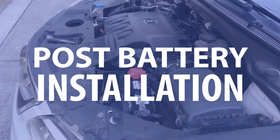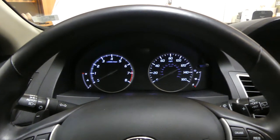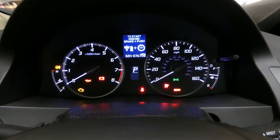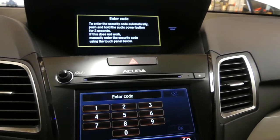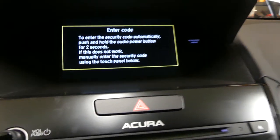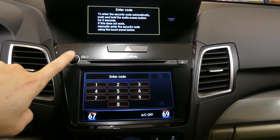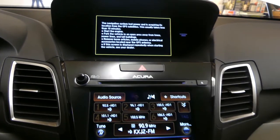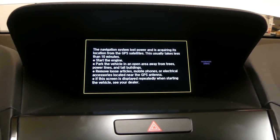I like to do a quick test by turning on the ignition and making sure the new battery works and all the connections are solid. If the engine starts up and there are no electrical issues, then you're pretty much done. For those that have the Acura RDX with the technology package or advanced package with the navigation system: after restoring power, your navigation system will show that it is locked and require a security code. Push and hold the audio power button for about two seconds and it will automatically enter the security code for you. If that doesn't work, contact your local dealership or go to the Acura owner's website — I'll put the link in the description below.